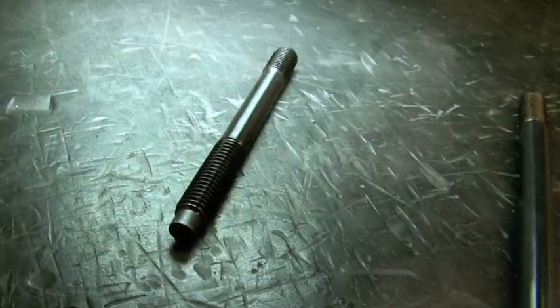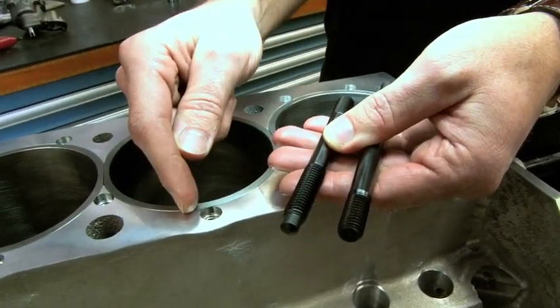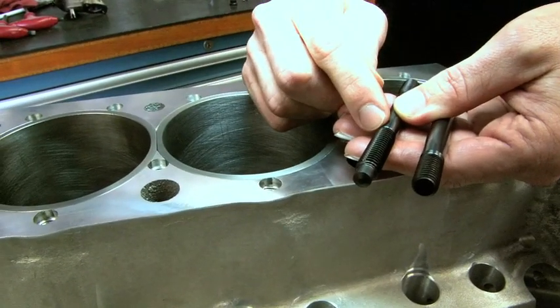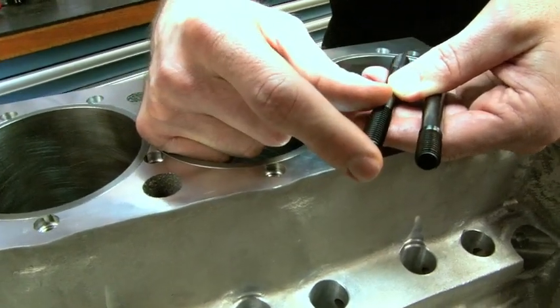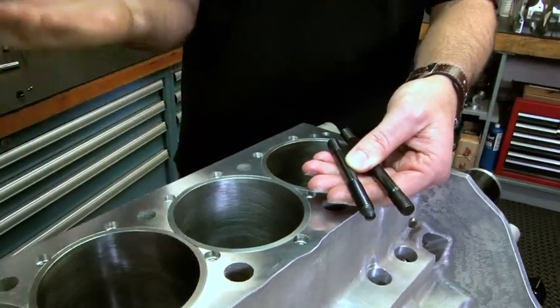So here's one for aluminum. First of all, you can see I've got more thread engagement here, so I've got more threads to pull on. The second is this bullet nose feature. This is nice because I don't bottom out a shoulder — I bottom this out in the bottom of that bolt boss. Then I put a little bit of preload between the bottom and the threads. Now my stud is engaged and it's ready to start putting my head gasket down and my cylinder head down.